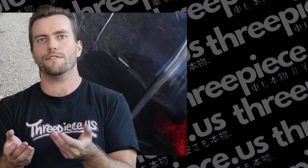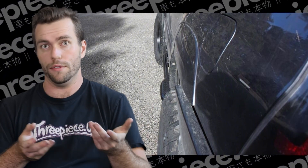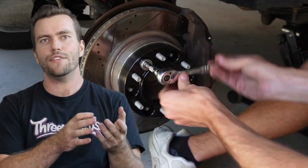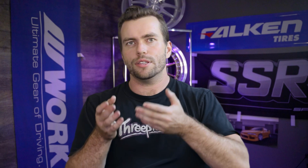A lot of runners with aftermarket wheels are using a negative offset, for example negative 1 to negative 10, and if you're in the market for wheels, you're probably getting lower offset anyway. Bear in mind that most will require some additional work, so for a bolt-on fit a +12 is good, but if you want to lift or trim, you can do a lower offset. A good rule is when turning lock to lock, you're going to lose half an inch of clearance for every one inch that your new wheels poke out compared to stock. So if you put one inch spacers on your stock wheels, you're going to lose half an inch of clearance when turning. We're going to explain this further in the OEM Plus fitment section, or check out our guide linked down below.